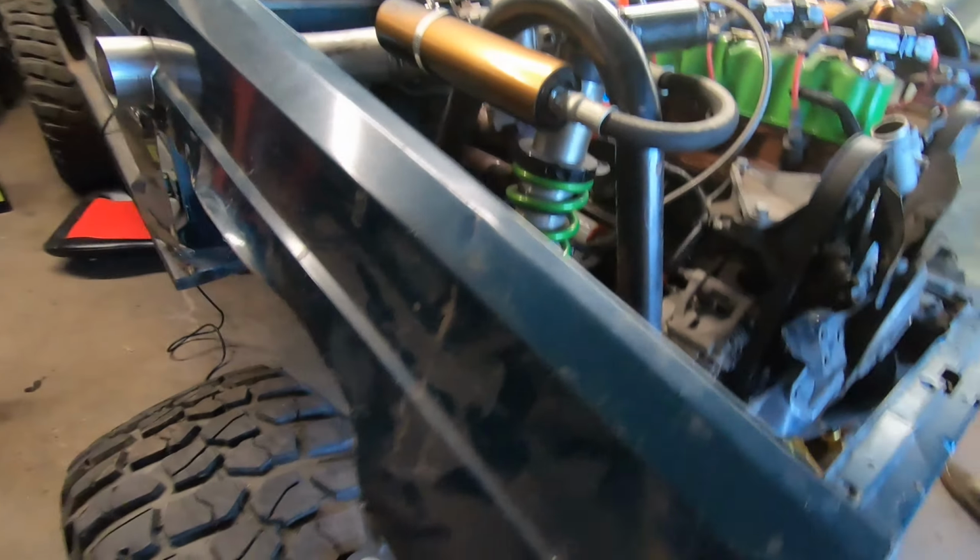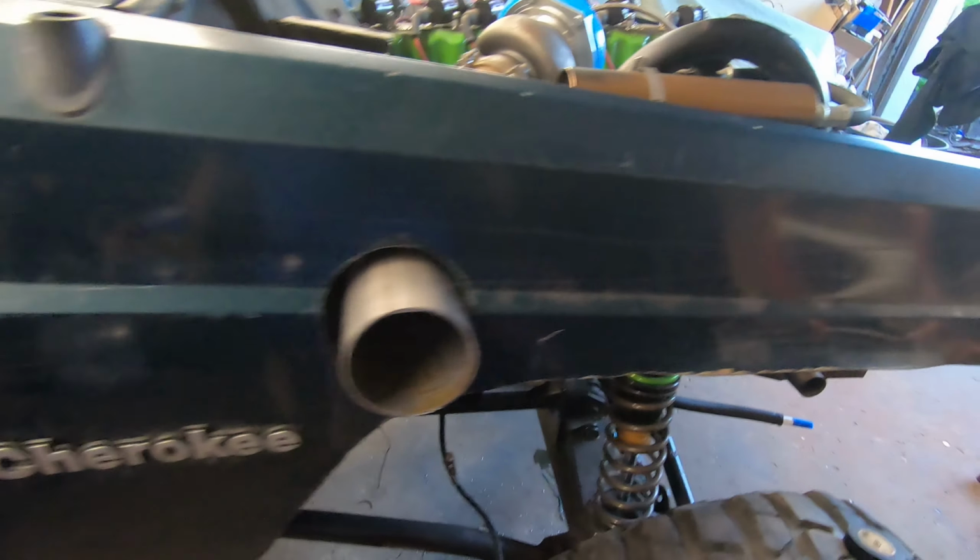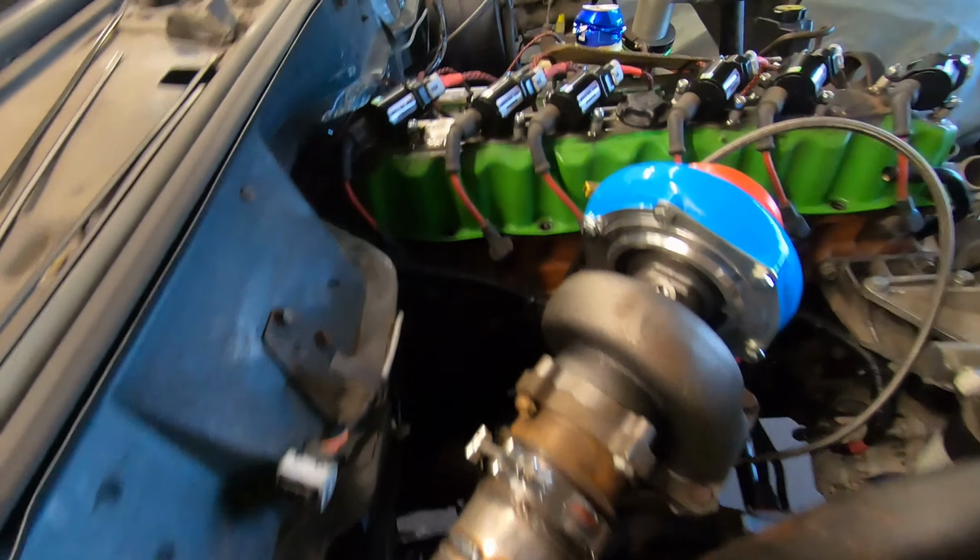As my brother was playing a little fender games here, I did a little more ground pounding and finished up this ground I was talking about. So I put a little insulation on it, but that ground is going from the engine itself. It's coming through here, and it's gonna go straight back to the battery. And then I'm gonna have one off the battery to the frame again.